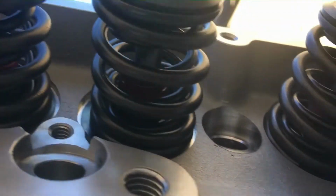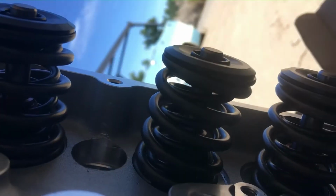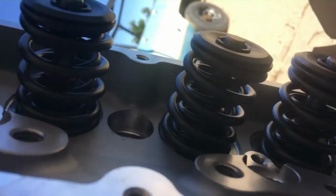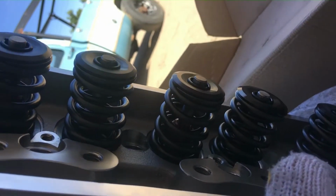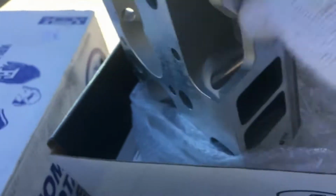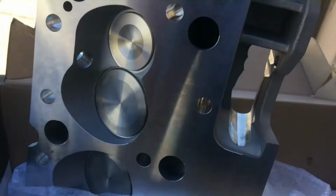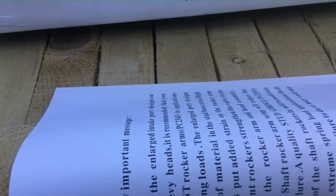And here's your intake ports. Nice and big, like 220 CCs. There's my dual spring valve springs, which are set nice and hard. Good for almost 600 thousandths of lift. 0.6 lift. Anyway, I might be getting the stats a little bit wrong, but look at these nice small block Chevy heads. Very good job with Speedmaster 79 on eBay.